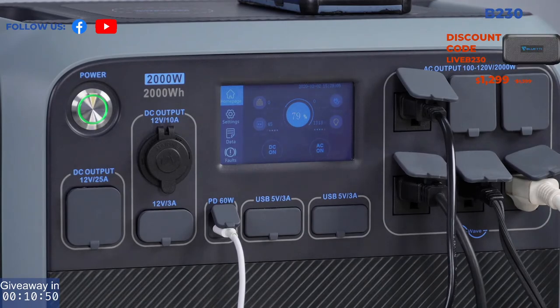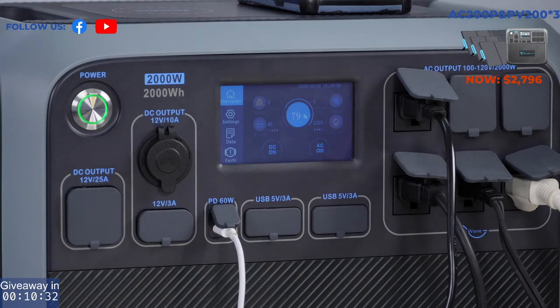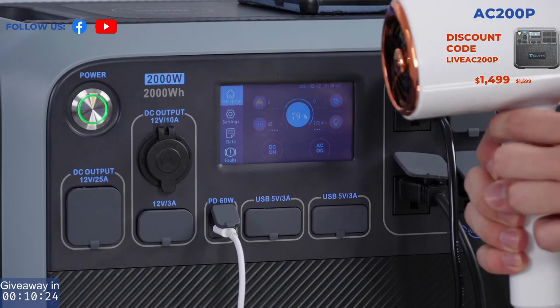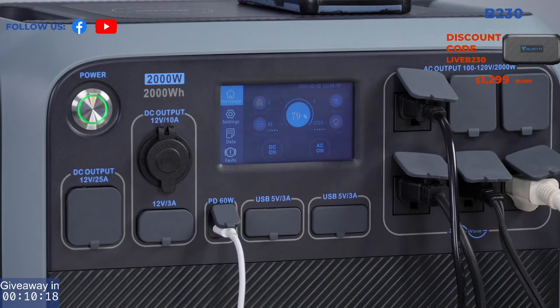Yeah, okay, clearly it's too much. Yeah, because of the hairdryer, but let's try the hairdryer with cold air right now. So let's see. Oh, you guys see how different it is? So with hot air, it would be 2,500 and it goes even higher. But if I press this button, which is for cold air, the load is much lower. 1,500 only. And once I release the button, it goes all the way up.